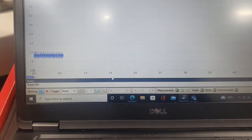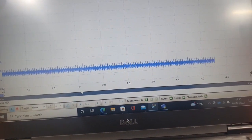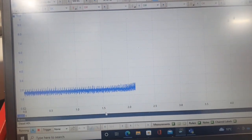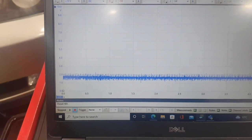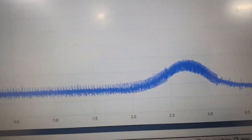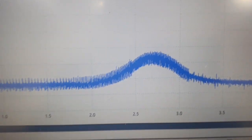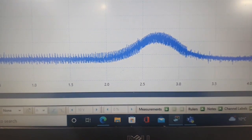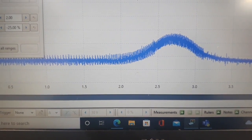I have an oscilloscope set up and someone in the car to rev the engine. I want to see what voltage the boost pressure sensor gives at wide open throttle. Looking at the waveform — bringing back the wave — it should sit around 4 volts but this is a 2004 vehicle with some wear. After filtering, I can bring the cursor down to measure the peak.